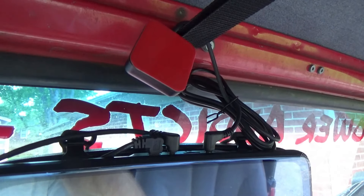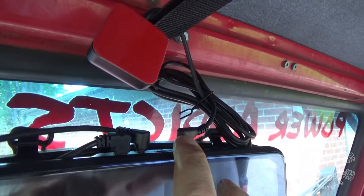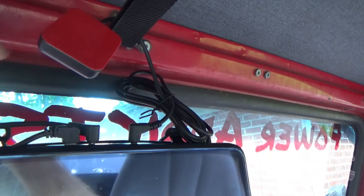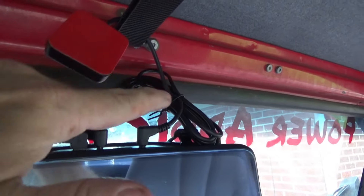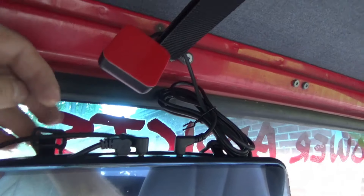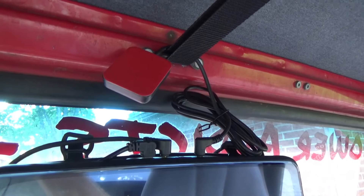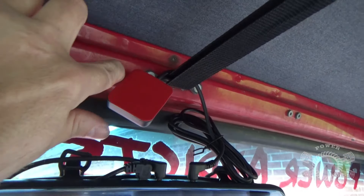As you see here, I've got my wires plugged in. This is the power, this is your rear backup camera, and this right here is for the GPS module. The GPS module I've just got hanging up here right now because I'm kind of on the fence where I want to put it. I'm seriously thinking about sticking it right up beneath this right here and keeping my cord nice and neatly tied up, tucked in behind the mirror. Probably zip tie it to those little straps. Little voices in my head tell me to keep the GPS module up high. But if you want to put it under your dash, you can do that as well.